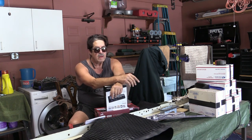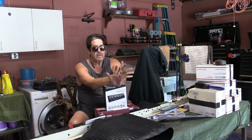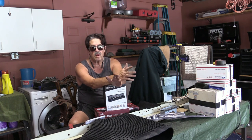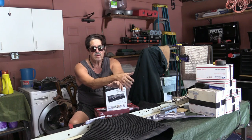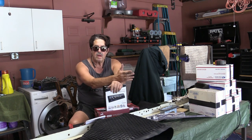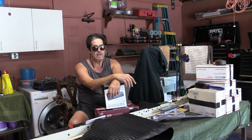I covered the sanding and painting process in the video and I'll show you the still pictures — this thing came out really sharp looking. The metallic Dupli-Color comes with a small can of hardener at about a 50/50 ratio, easy to mix. I put on two coats — a light coat overlapping 50 percent, waited 30 minutes, then the second coat. You can add clear coat, but with this metallic it has a really nice shine already, so I'm leaving it as-is.